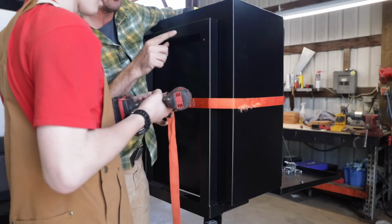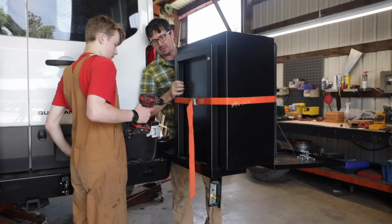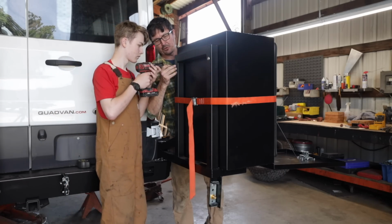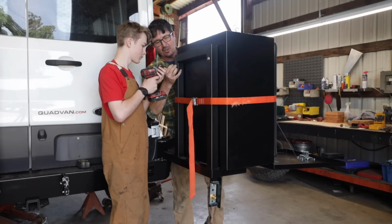Very carefully. Remember, this is aluminum, so you don't have to drill too hard. You're going to line it up till you're in both holes. Go ahead and line it up in there, like I showed you. Careful when you're going in. These are the type of things, not to scratch the surface. So what I do is I put my hand on the end of it, like this, and I come in, I get close, and then I go in.